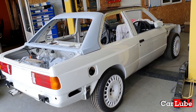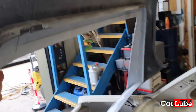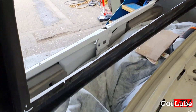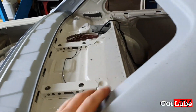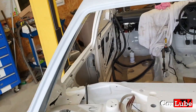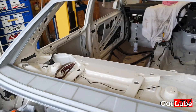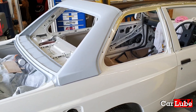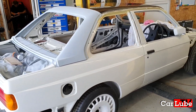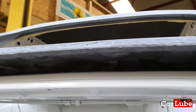This is a carbon fibre window frame — you can see inside that the entire piece is carbon fibre with all the internal structures present. These do take considerable adjustment, but once you get them fitting right they fit as well as an original. They are quite tight to fit on the car, but that's just the way BMW designed them — they're literally a loop on and a grip over on the original car, so it's just a window frame extension. There is an under-parcel shelf extension to put in, and that is the last part of the body conversion we have to do. You can see underneath there is a gap, and the under-parcel shelf extension glues to the underside of the original parcel shelf — the gutter itself — and extends out to the new gutter.